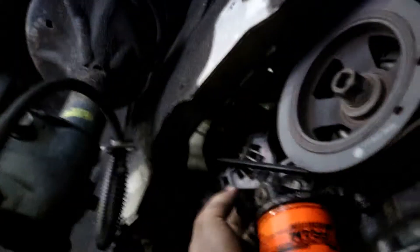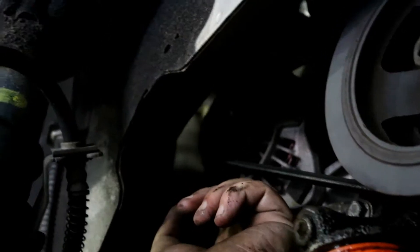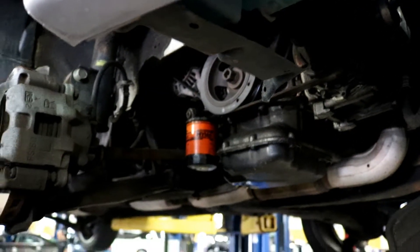This is my big issue with certain Japanese cars and tiny four cylinders like this. Your alternator is up in here — if you look at the very top you'll see a manual tensioner, and then over there there's a spring tensioner pulley. So you've got OG stuff and new stuff in the same place. It's not like I could just make it all happen at one time, plus there are two separate belts, which I don't understand why they did that.